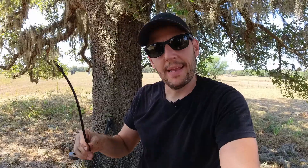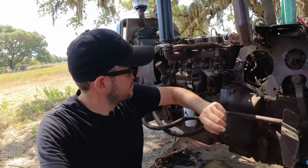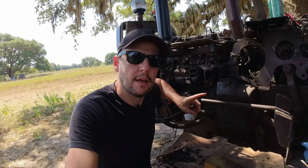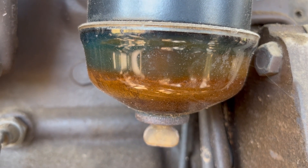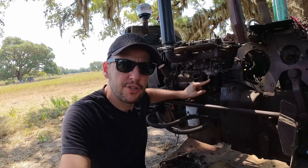I'm not going to install the line from the gas tank to the hand pump yet, because I don't know if I want to make a new one with an inline filter. The gas tank has a strainer but it's not a very good strainer, so an inline filter would be extra safety. Next in line is the fuel filter — because the gas tank had a lot of rust inside, some rust got into the filter and I can see approximately half an inch of rust at the bottom of the cup. I'm going to remove the cup, clean it, and change the filter.